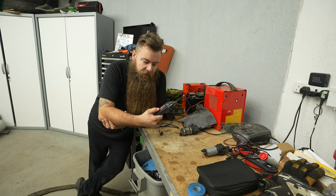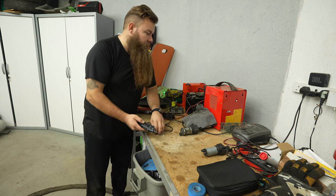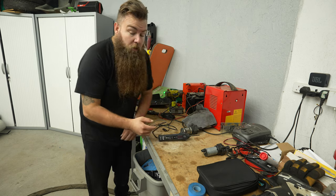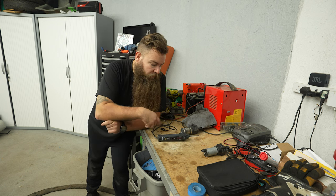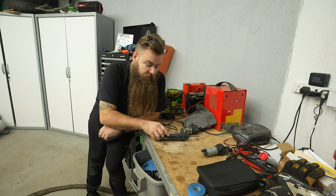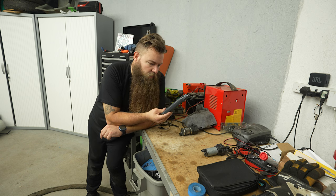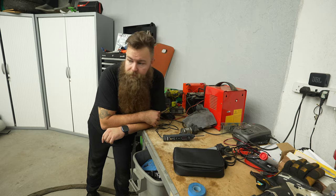This tool — the Power Probe — was 20 pounds off eBay and it allows you to test voltage, like on a battery, and it will tell you if there's voltage there. You can also put power onto things — so if you've fitted a stereo and need to test a permanent live, it's magic. It'll also tell you the voltage something takes. Very cool piece of kit — I'll stick a link in the description. It's a US Pro one, 22 pounds delivered, and it comes in a little snazzy case.